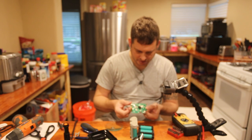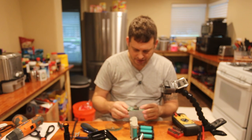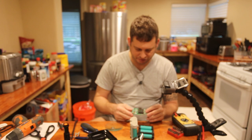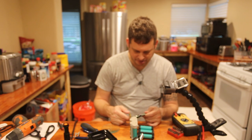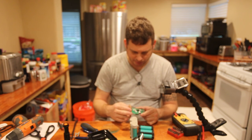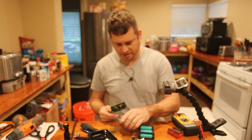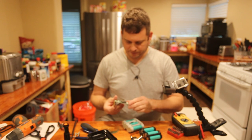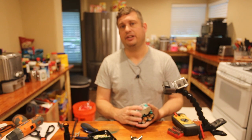It's always kind of interesting to take apart dead stuff and see how they put it together. There's a fiberglass insulator and the battery pack is held in with long screws. At this point I'll recycle the pieces that are recyclable — plastics go in the recycle bin, electronics in the trash. I still have no idea why it died. This was made in May 2015. I really think the failure is in the circuit board, and if I had to guess I'd say it's a capacitor failure. This 22-microfarad capacitor has a little bit of junk on it — I think that's the part that went bad. Something overloaded the capacitor and caused it to fail. The second capacitor is all clean. I think each battery pack charges independently and C25 — a freaking five-cent capacitor — is probably the cause of failure. If they would increase the quality or bump up the value to say 25 microfarads, this problem would go away. Anyway, thanks for watching — always dispose of this kind of stuff safely, and don't throw it in a fire because it could explode.